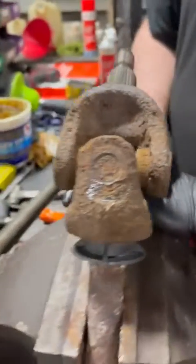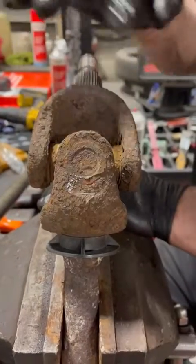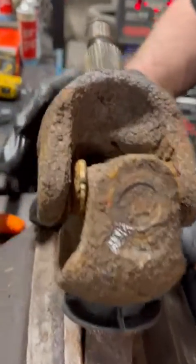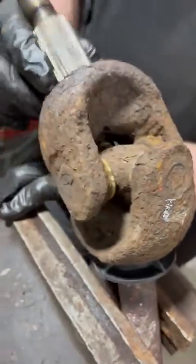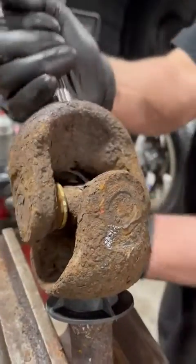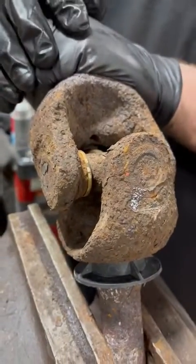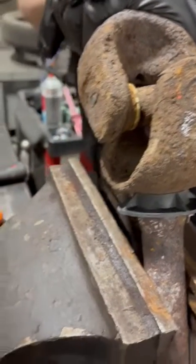This is out of a Jeep product which uses the old-school style Universal Joints. Now this is one we have not removed yet, but as you can see it can move nicely this way but does not move at all the other way. These U-joints are seized in here — it happens with water intrusion, moisture, road salt, that kind of stuff during the season.